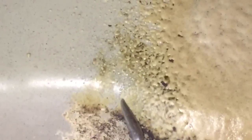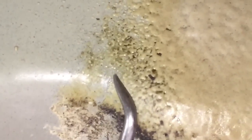About here, going up through that sort of area through the seam sealer. So we'll lightly take that sealer off, see if we can find the ends of that crack. Might even need to heat it up or even dye pen it, and then stop drill it.